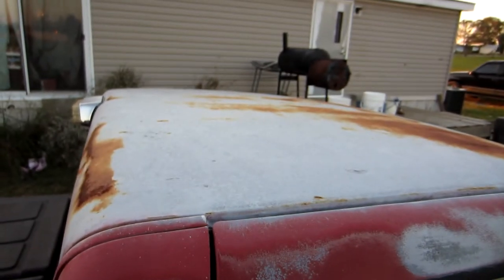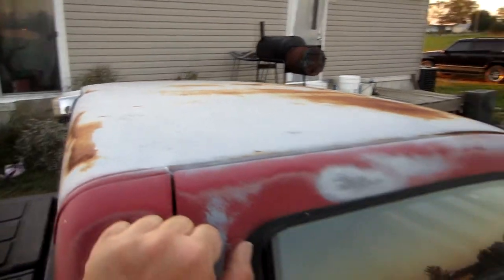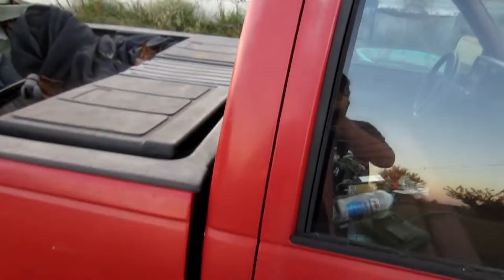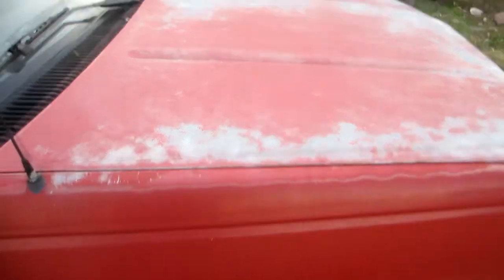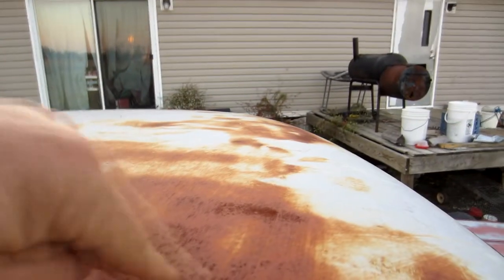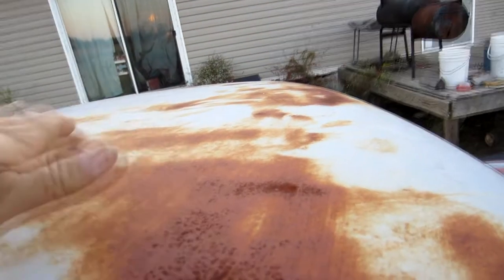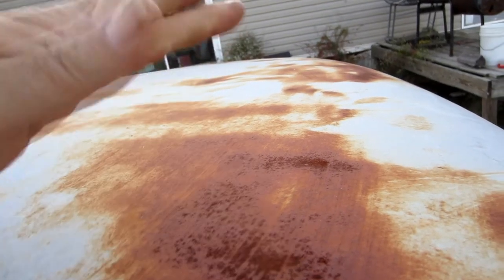I've got a picture I'll insert right here. In that picture all this is still shiny and waxed up and polished — shiny, polished hood. First thing to go was the clear coat, and then the rest of it just pretty well blew off just sitting here, partly because I didn't have it covered. This was just a little spot. Of course, this is just surface rust. I've already sanded it off once, but I was stupid — didn't know what I was doing, didn't know to use metal etching primer.